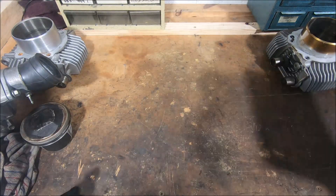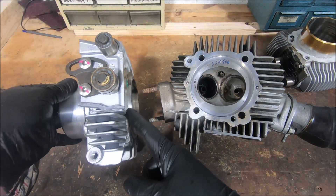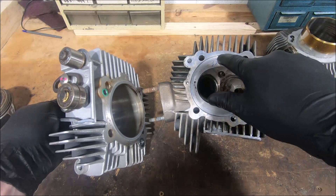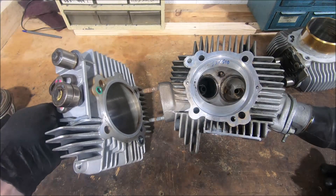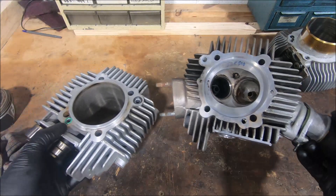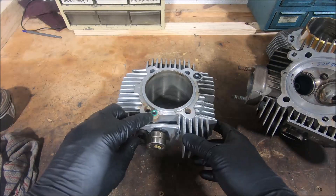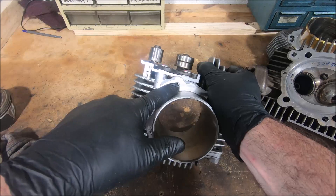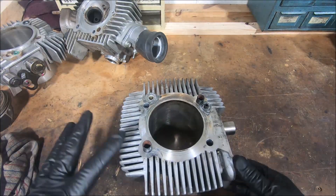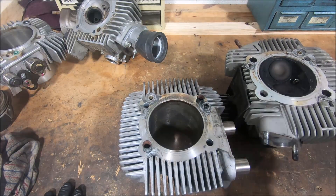The difference in the cylinders and heads: this is the 800 cylinder and head, and you can see there's a step on the top of the cylinder here, and that step surface sits against the flat surface of the head. So these early engines had no head gaskets - it's just a metal-on-metal join, and it by and large works very well. They had O-rings here that seal the oil return, and that's the oil feed to the head which is O-ringed, and the base gasket oil feed there. Whereas on the later design engine, the head is flat as you'd expect to see - head gasket - and then the head's corresponding flat surface just mates up against that.